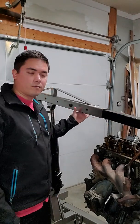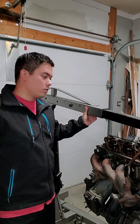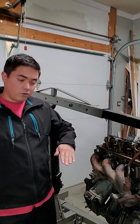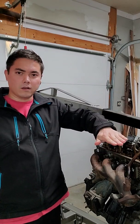the bad part is that my Harbor Freight two-ton jack decided it didn't want to work anymore. What it's doing is every time I try to pump it, first of all, it's going super slow and then second of all, it only goes up to a certain height and won't go up anymore.